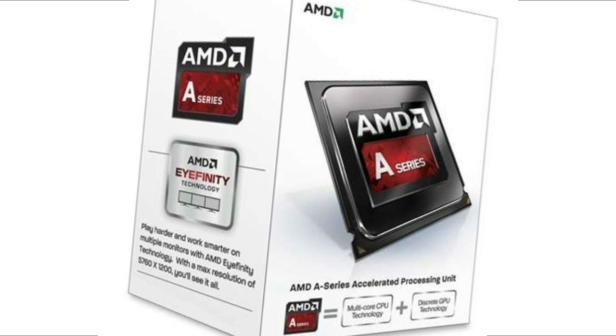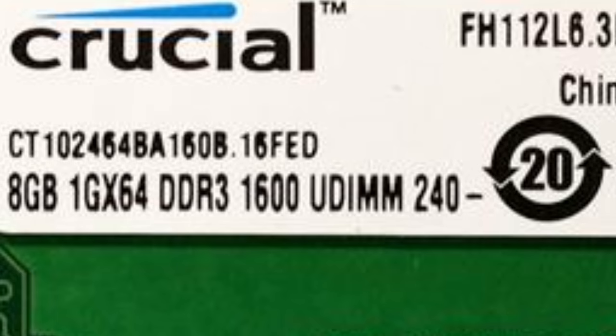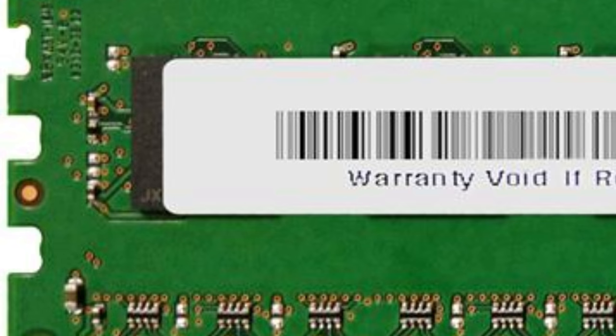Ok, we're almost there, so I'll move on to RAM. When editing video you should think of RAM as a kind of buffer — the CPU generates the output and pushes it to the RAM, and the RAM is then written to the storage. The more RAM you have the better. For our budget solution I've opted for 8GB of Crucial RAM, full product name CT102464BA160B, with a speed of 1600MT/s. It's cheap and it's perfect for our budget editing build. The stick of Crucial is just £25.49.